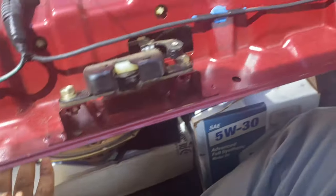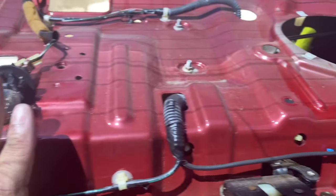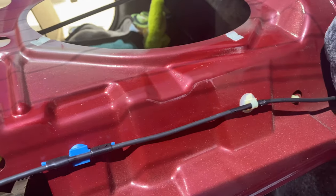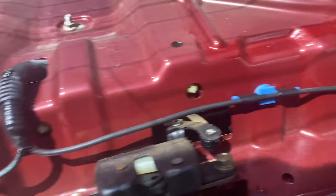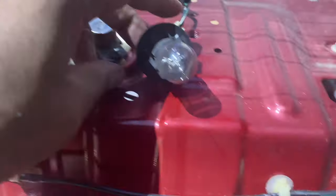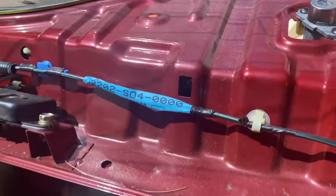New day — I actually had to stop, so I couldn't finish the rear speaker install last time, but it's another day. I went ahead and tried this myself. I watched a couple of YouTube videos on this, but you can actually pull this from the bottom. There was a trim piece for the lock here. You have to unplug the light for the third brake light and also unscrew the child lock. But I was able to get the speakers out.